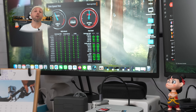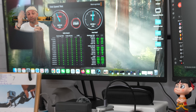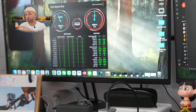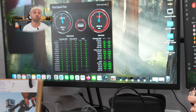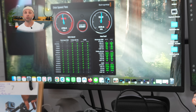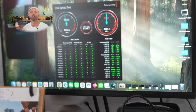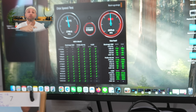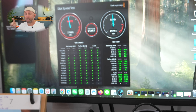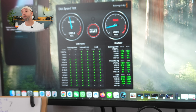It's completely plug and play — just plug it in and go, apart from initial SSD formatting. You can easily swap the SSD since there's no fan or complex internals. M.2 SSDs are available at all price points and speeds. We chose Western Digital Black, but it also works with Samsung — I see there's a 990 and even a 990 Pro. A speed of around 3000 megabytes per second in both reading and writing would be more than enough, and it delivers that quite well.